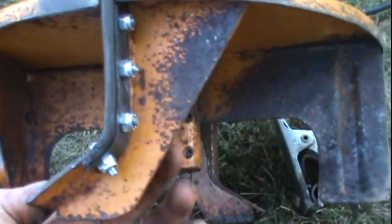One down, three to go. It's getting pretty dark out, but I stuck the impeller in with the one rubber installed and you can see that gap is filled. It's a bit dark to see, but there we go — that'll wear in or we'll trim it. It's going to take some paint off if we decide to paint this snowblower. That's what it does: fills that quarter-inch to three-eighths gap.